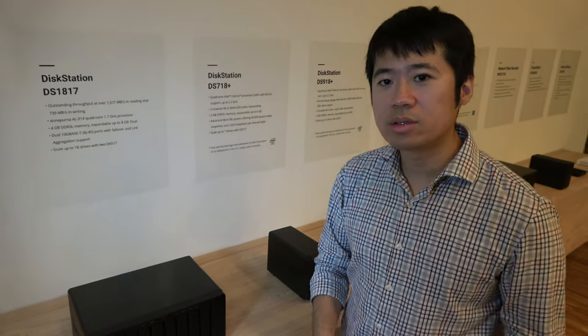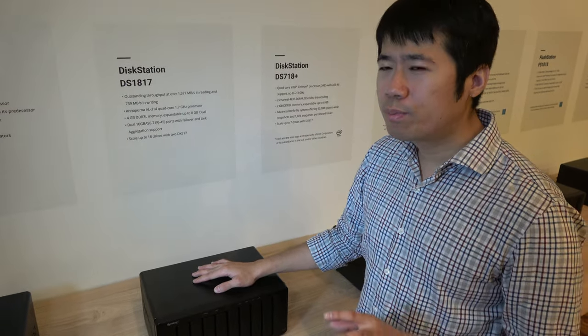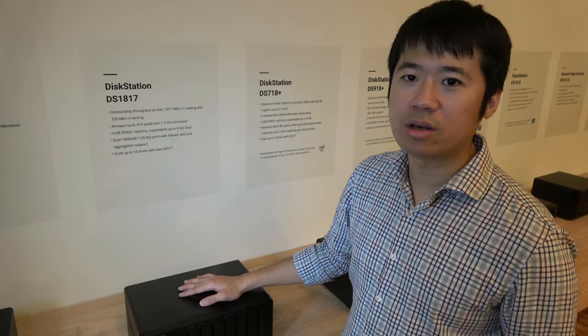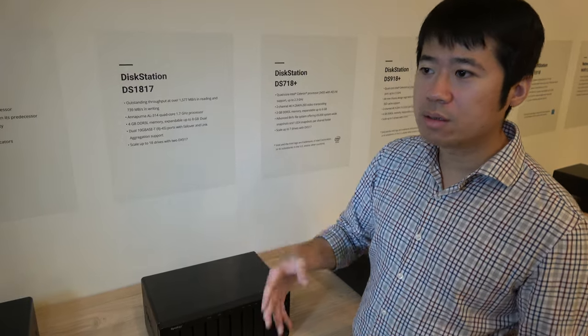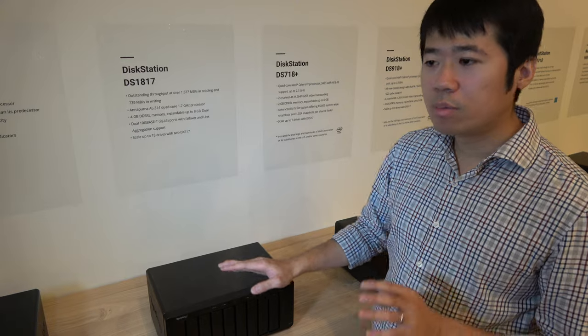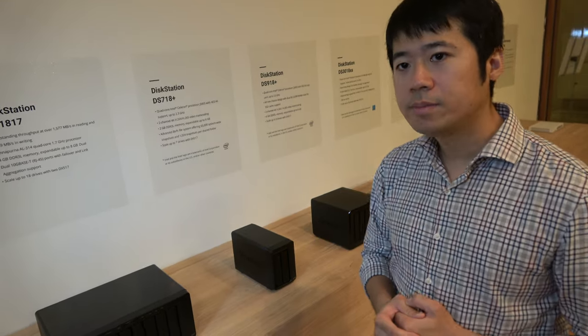Well, again, it depends on your usage, how you use your Synology NAS. If you're just a regular home user or a pro user at home, you probably don't need the SSD cache at all. But if you run a small business or office environment, you will probably want to consider installing two SSD caches. Maybe 128 or 256 GB SSDs, not expensive. Like a hundred-something dollars? Yeah.